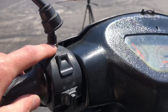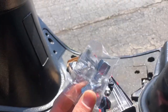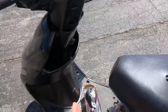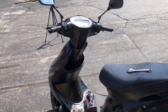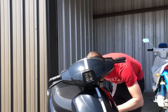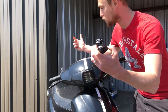Getting your mirrors off is pretty easy. There's only one nut right here that you twist to the left and it just threads out. To my knowledge, these are 8mm threads on this bike stock. The good thing about these mirrors here is it comes with an 8mm thread right there, but it also comes with a 10mm adapter. So even if it isn't, you got both worlds ready to go. These mirrors just look so high up. I'm going to leave a link to the parts down below — all these parts together were about $100 from Amazon. Gotta love Chinese bikes. The adapters are definitely coming in handy because the stock thread on this does not fit — it's way too big. But all you do is you thread these in here, and then they screw on top.